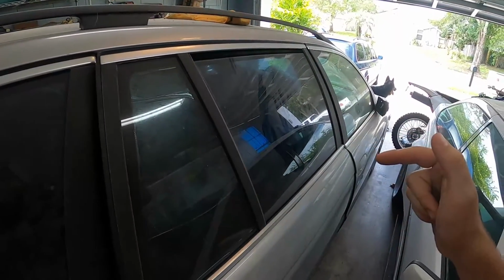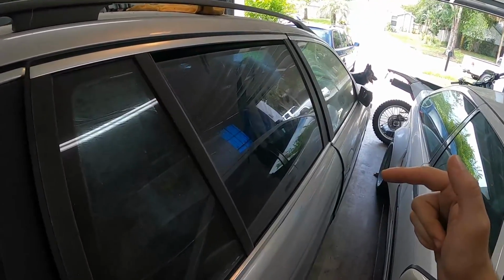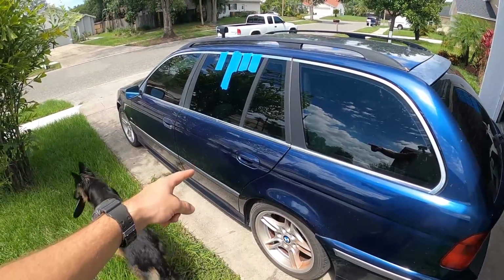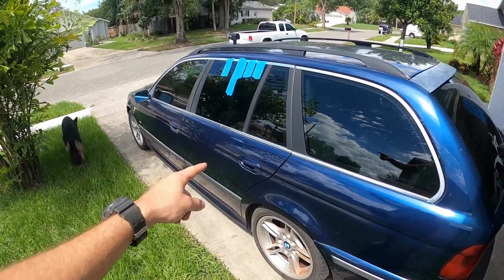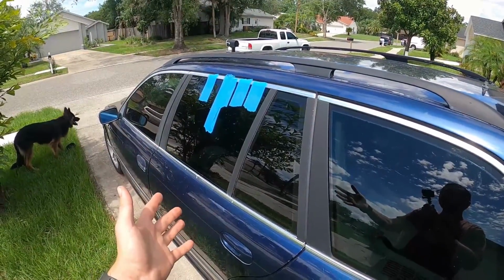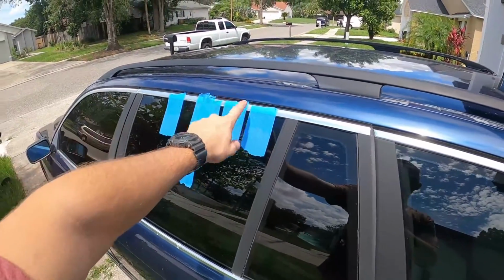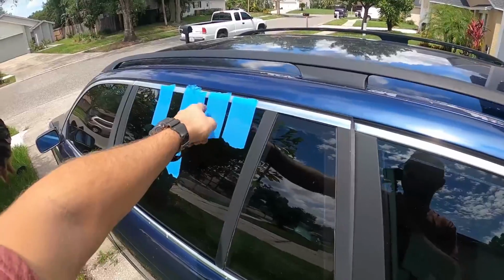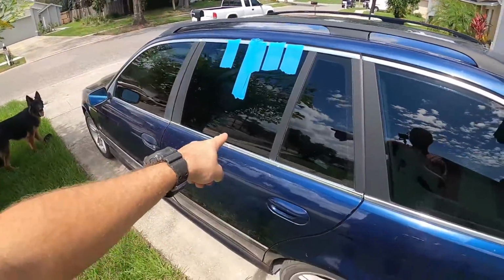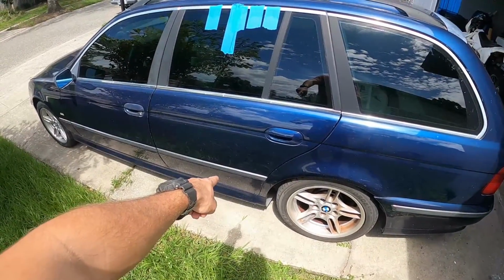And so here on this Titan Silver car, the passenger rear window regulator is out. And on the Biarritz Blau car, the driver's rear window regulator is out. So they're just mismatched, but obviously this is a very common problem. And what I've done on this car, since I'm temporarily storing it outside, is tape the window closed, and that ensures that no more water gets inside. I'm pretty sure this is the culprit to why the plug down below started rusting out in the first place.